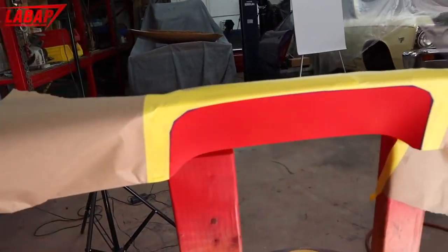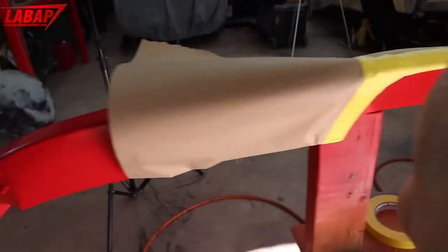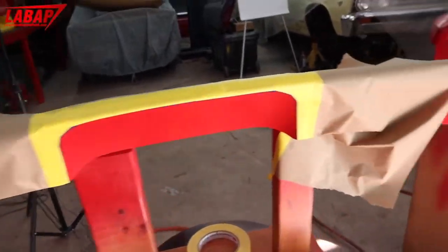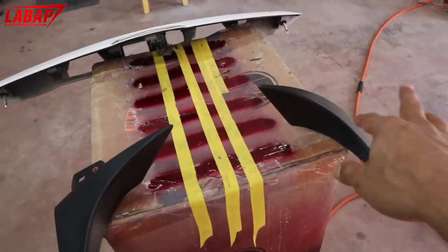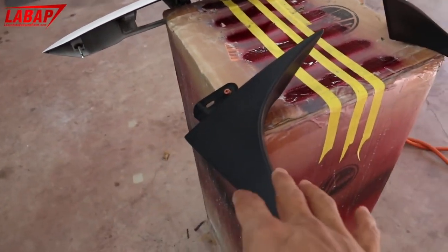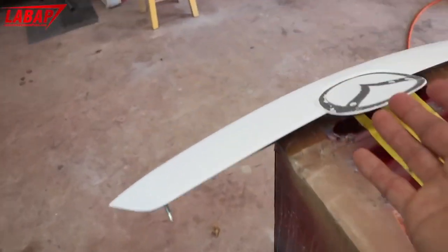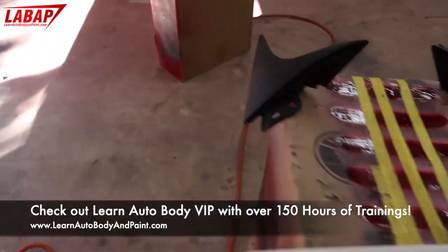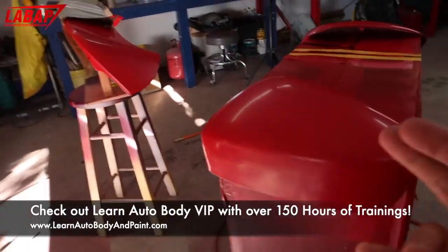All we're going to do is dust this area. If we do get overspray on this, it'll wipe right off with the tack rag. It's not a huge deal, okay? We're gonna spray some quick adhesion promoter on these bare plastic pieces, and then do our black base coat. This, we're just gonna do black base coat, all right? Once this is all dry, then we're just gonna candy our red.